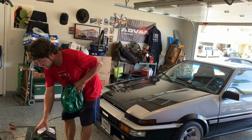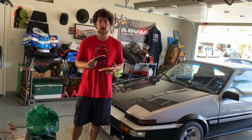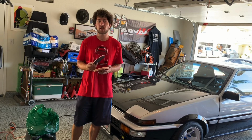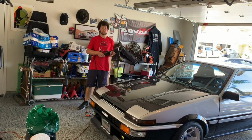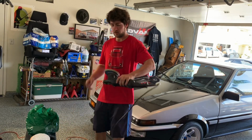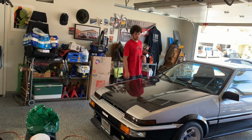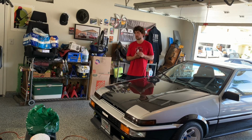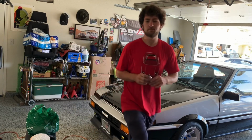What I've got with me today is a Meguiar's microfiber pad and a Griot's Garage orange cutting pad. This is a more aggressive foam pad, but sometimes the aggressive pads with a fine polish will actually finish out very nicely. So I'm going to start out using the microfiber pad and Classic Cut. I've got my Rupes 6-inch polisher. This is the Mark II. I think there's a Mark III out right now. I'd love to get that, but this one works just fine. We're going to remove some defects so that we can get this carbon fiber on this beautiful little Corolla looking really nice. Once I'm done, I'm going to apply Fine Lab Ceramic Light, your 1-year ceramic coating that is also available to the consumer, onto the paint as well to provide some really nice gloss and protection.